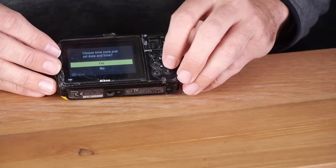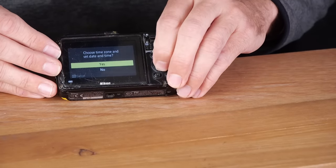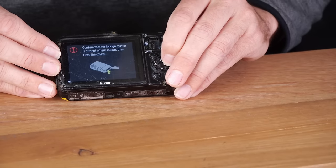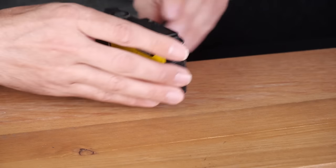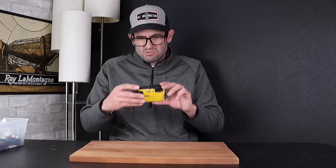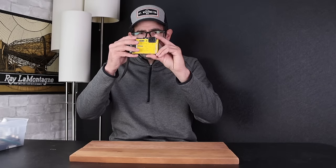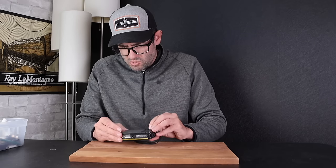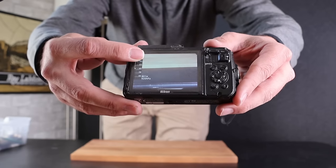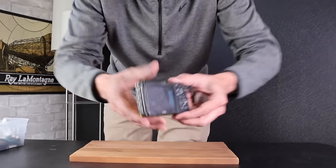It does turn on. Look at the button wear too — just rough. We've got the menu on at least. Let's try taking a picture. The zoom actually works. As I zoom out, I'm seeing a black spot visible in the picture — not so much when not zoomed at all. Normally that would be an indicator of dust inside the sensor. The black spot is right there, and it becomes more pronounced as you zoom out.